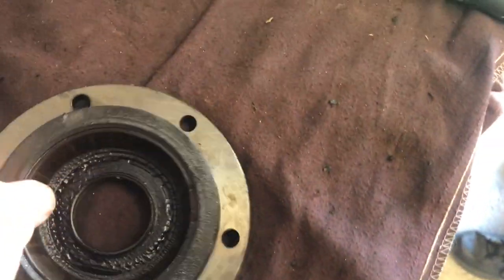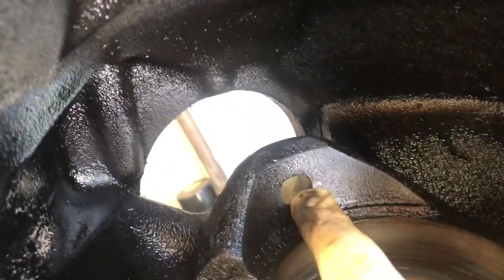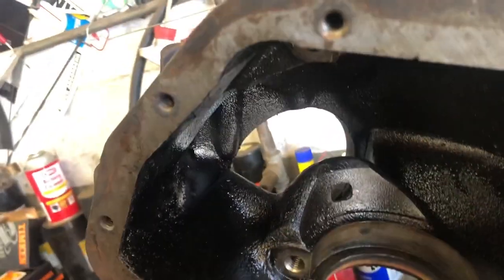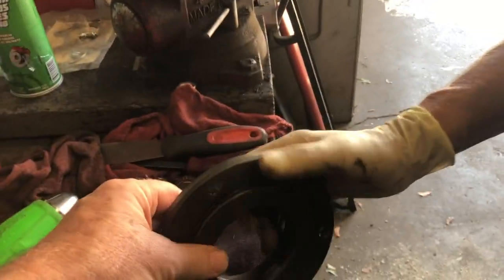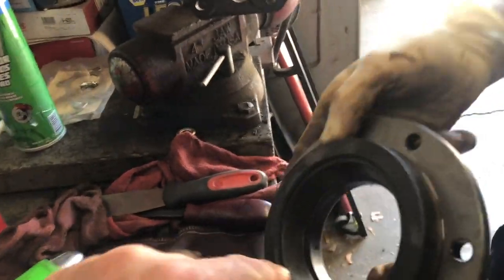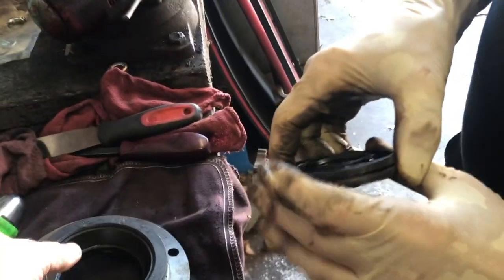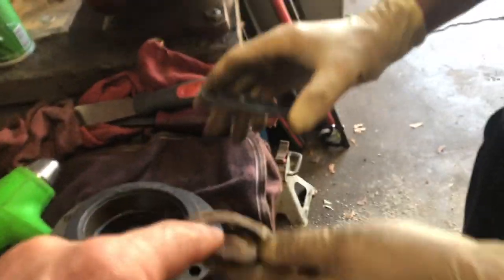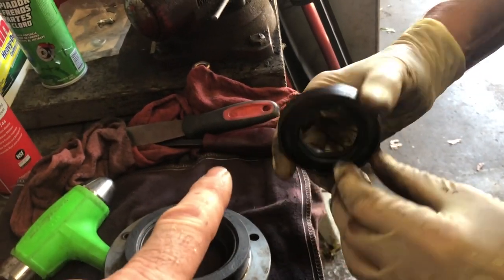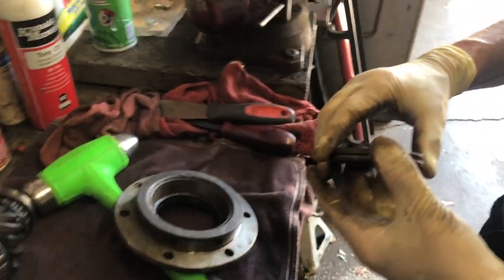We'll get the rest of that gasket off. This hole gives you just enough clearance to knock out the race — the front race. So this goes into that there, which then comes out there. There's a little hole, and there are two seals that go in here opposite of one another, and it goes in between the two seals. The point is that if differential fluid goes this way or transmission fluid goes this way, they go out of there and drain out — and don't mix. That's the best we can figure for what that setup's for.